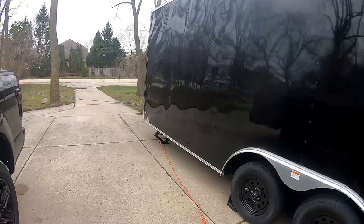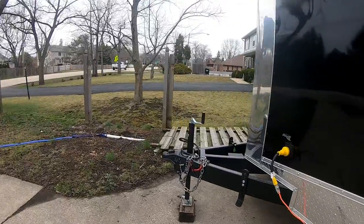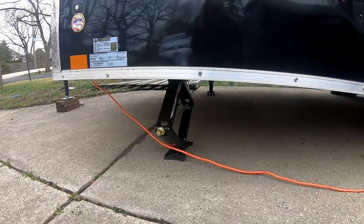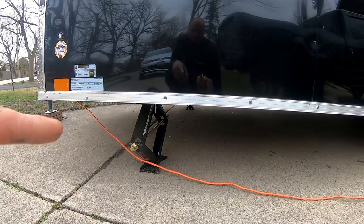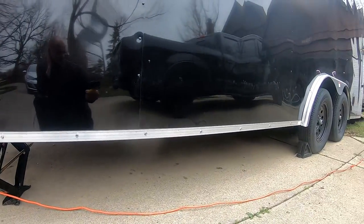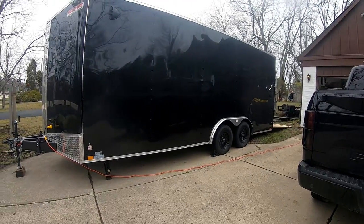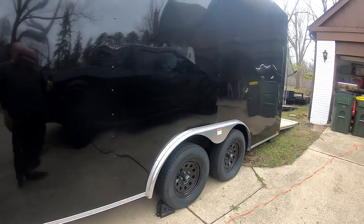We do plan to leave again for the same trip next Friday — a week today. I've been back in the trailer for about a week just trying to make it as comfortable as possible, so I'm going to show you what we've done. Starting with the outside, I've gone for these stabilizer jacks — massive overkill, they're 5,000-pound weight rated each, one in each corner. Even when a trailer like this is hitched, it's very bouncy if you're living in it. The stabilizer jacks make it a much nicer place to be inside — it really doesn't move at all now.